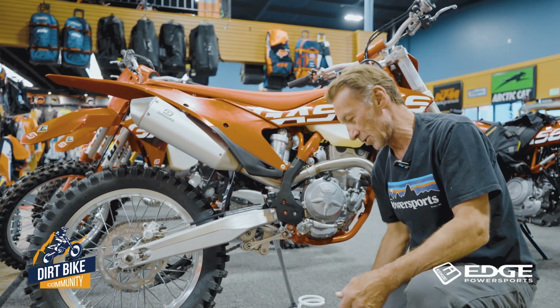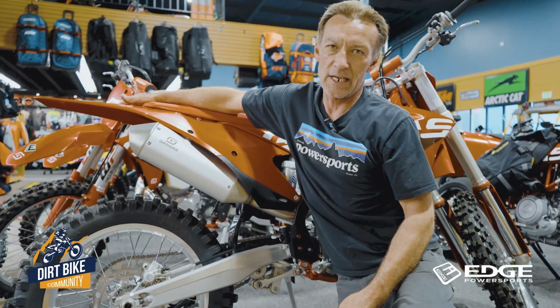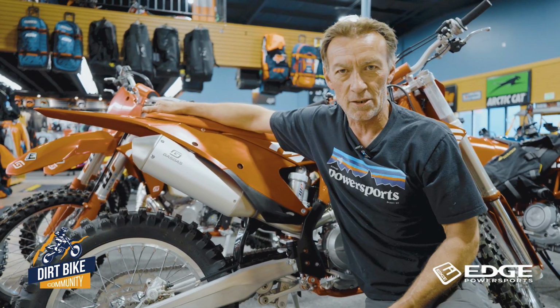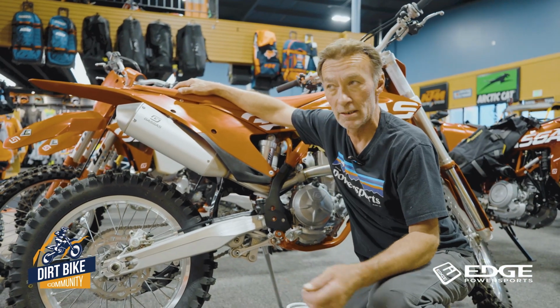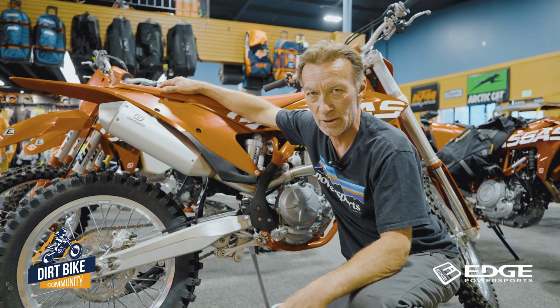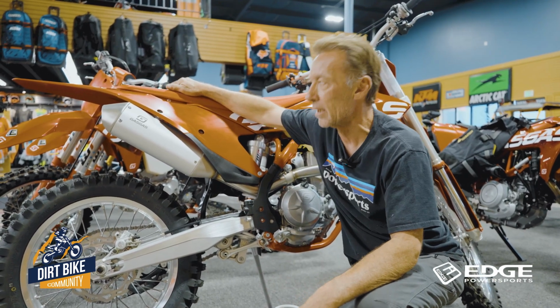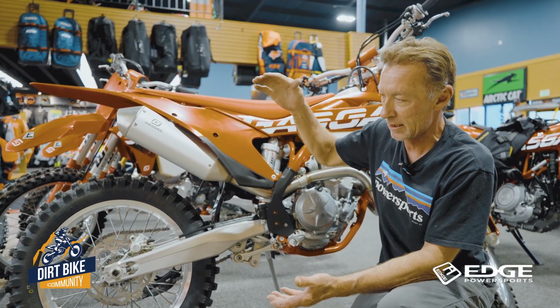And there's actually a little measuring tool we use. Nice thing about all these models of bike is there's actually a permanent sag mark on the opposite side of the fender that you can always measure from. If you don't have one of those measuring spots, take a piece of electrical tape, put a cut into it with a razor blade or something so that mark never moves on you. So ideally, you're going to get that measurement and set your sag appropriately.